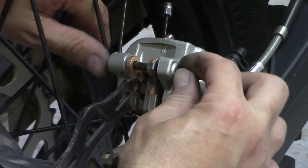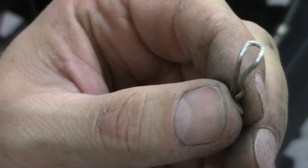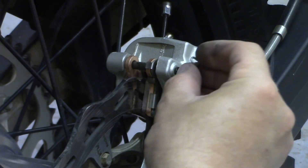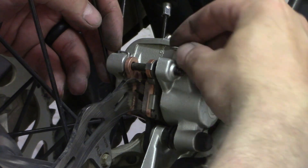To get your pin back in, get your pad lined up, then come through and get your second one lined up. Get your retaining pin right there — that's what the bottom looks like. This slides over. Just put the pin in the hole — sometimes you've got to give it a little turn.